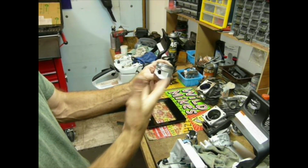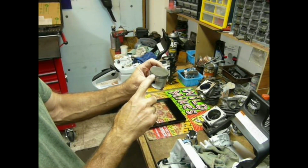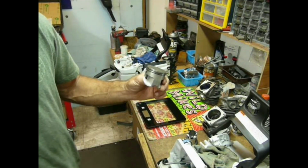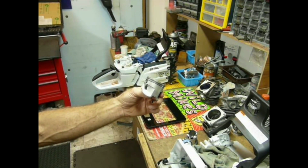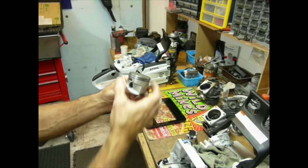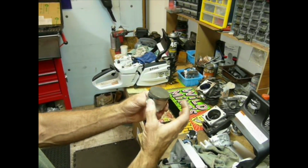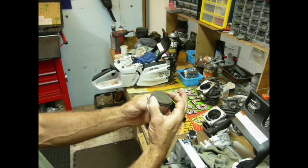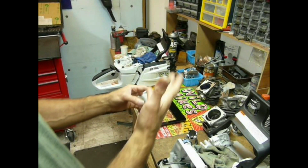Again, we're running a lot hotter in the process, going to allow for more thermal expansion, but I think it's about 3/1000ths or something, maybe 3/10,000ths. I can't remember now. Yeah, something like that, about 3/10,000ths. It's almost round, but not quite. So it's a little bit wider here than it is here. It's allowing for more expansion because the thing's running hot.